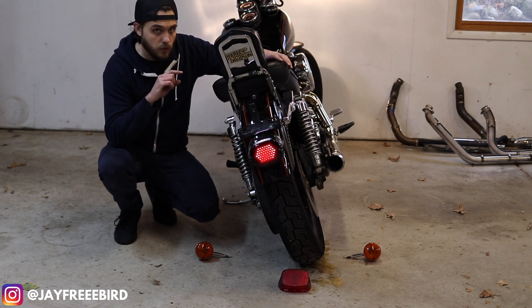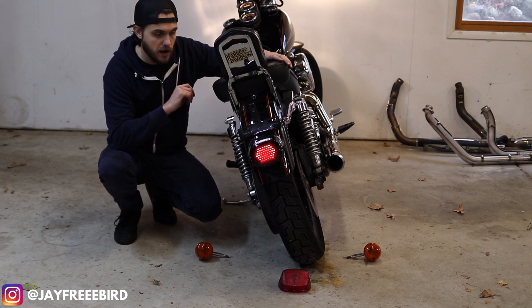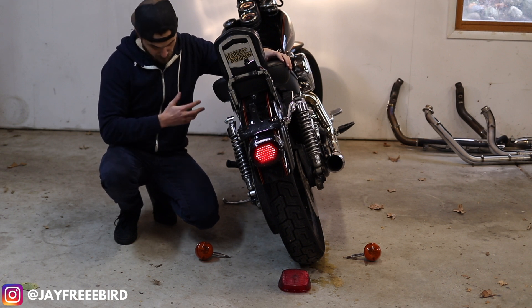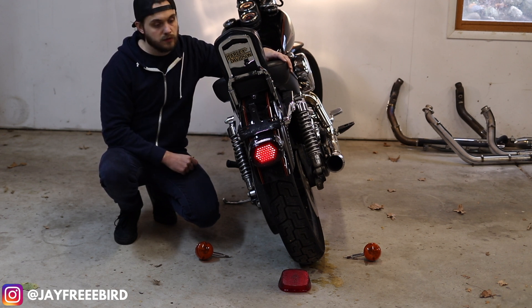Also to note: when you do the turn signal module and switch to that, your front turn signals will now be solid if you still have them connected. I've removed mine — I don't use my front turn signals. So you're going to have to either deal with the front solid turn signals, or switch to LEDs in the front as well. It's a little process switching everything to LED, but that's what you'll want to go with. There are multiple options — I'll be looking towards an integrated headlight turn signal. There you have the final product. That about wraps it up for the Moon MC integrated LED turn signal tail light for the FXR. If this helped you out at all, please like and subscribe — for those returning, thank you, and as always, stay free.